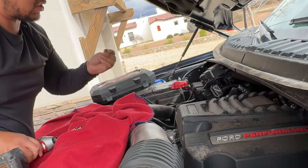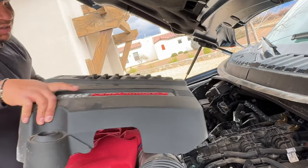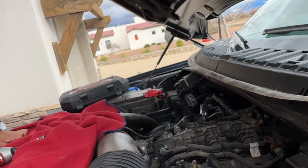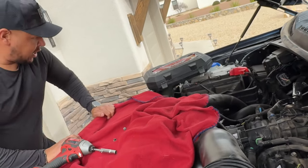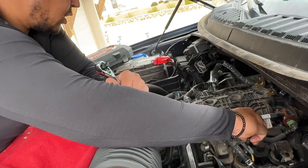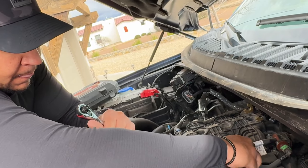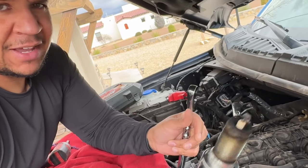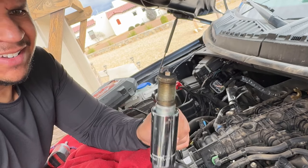So you pull the engine cover off, that exposes the intake manifold, and you just start pulling coils off, 8mm. Coils come off, then the plugs are there. Okay. Now we're about 3 minutes in, pulling the first plug. 70,000 miles. It's all right. Definitely needs to be done.